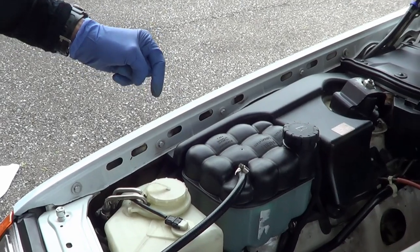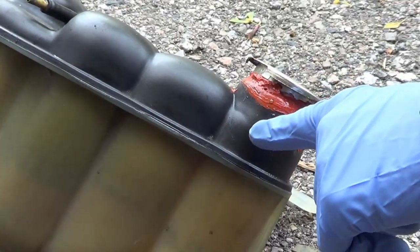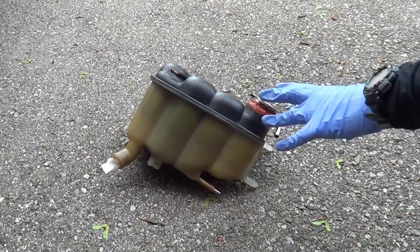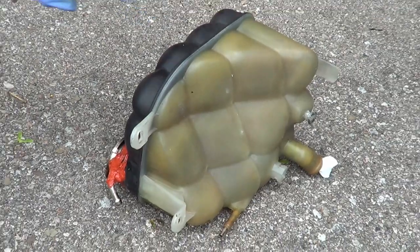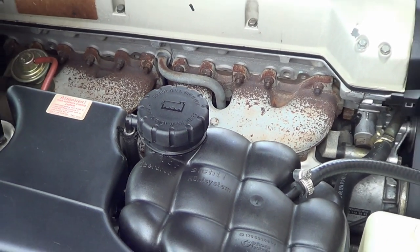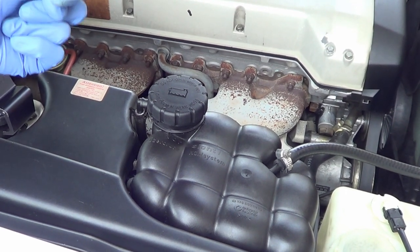There were a few important tips and pain points I'll share along the way, including the type of coolant. My tank clearly needed to be replaced — it started to leak a few drops from where the metal neck comes together with the plastic body. It's a common problem as these original reservoirs age. This one is clearly original and started leaking only about six months ago. I temporarily experimented with an adhesive glue, but without success. A drop or two may sound harmless, but it's critical that the coolant system be under pressure. If I'm losing a few drops, it's not under pressure. A system under pressure ensures a higher boiling point for the coolant, provides more protection to the engine, and ensures the head gasket does not prematurely fail. So that's why I replaced mine — not because I'm losing a couple of drops, but because I'm worried the system isn't holding maximum pressure for effectiveness.